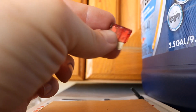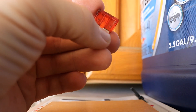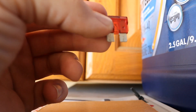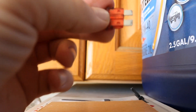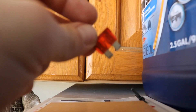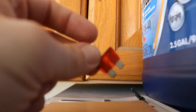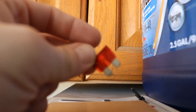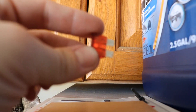Being the dummy that I am, I never even checked the fuses for the hazard — and there it is right there. After testing the hazard switch, it's in perfectly good condition. Now we still need to find out what caused these two fuses to blow. Was it a short? Did something get wet? It was a really damp morning. I'm going to replace the fuse, put the switch back in, and turn everything on to see what happens.